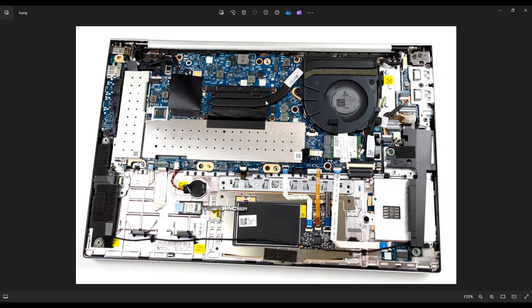This is your fan and your heat sink assembly right here up top. You can see your fan, your heat sink — this is your vent and it goes over your CPU right here. To get your fan out, there are a few screws: a screw here, a screw here, and some of you may have one up here, some won't. It's plugged into the motherboard right here. As with most things in a computer, avoid pulling on the wires — this especially goes for the fan. It's very small, very flimsy, very easy to break, so definitely try to manipulate that plug and not pull on those wires.